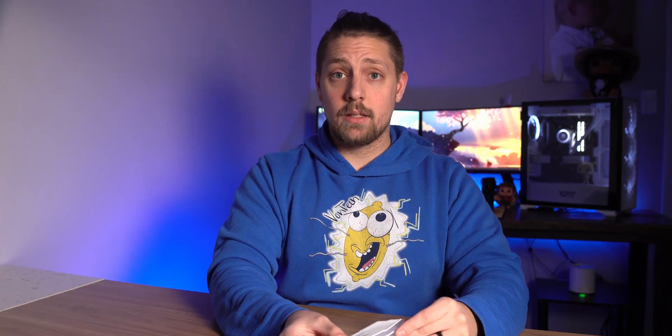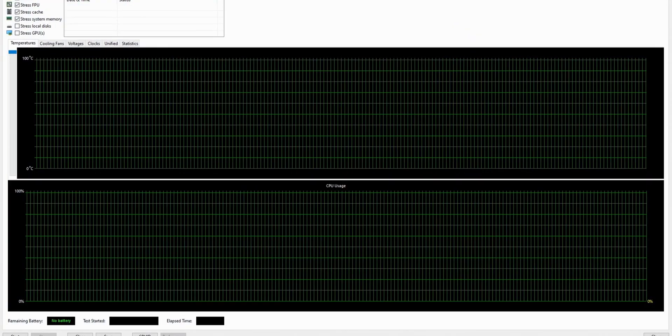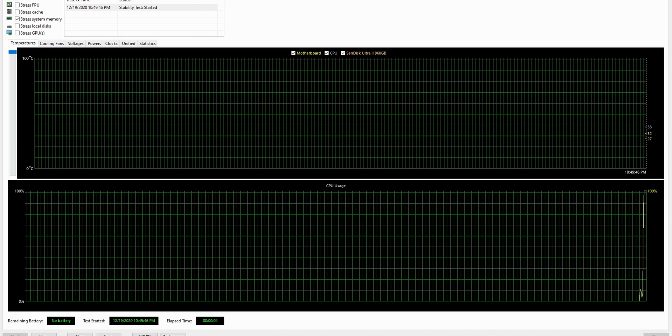So once you're done stability testing, I like to run the stress test from AIDA64 for a little bit. It's a free trial if you want to go ahead and download it and run the memory stress test. I like to run it for a little bit and also play some games, or I go ahead and re-overclock my CPU. A very important note before I conclude this video: you do not want to sacrifice overall latency for higher frequency. In most cases you're going to have to bounce back between frequency and latency to find that sweet spot for your kit.